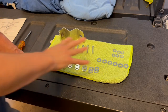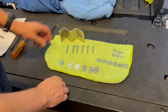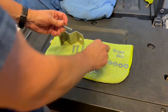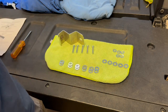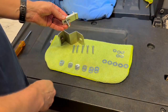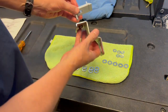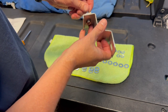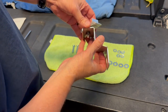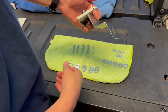I've got the hardware laid out — six pairs of large washers, each paired with a small washer. We're going to take each of the brackets: first take a small washer and a large washer pair, put it through there, then take a pair of large washers and put that on there, then screw it in. This doesn't need to be tight. The order is: small washer, large washer, then two large washers. We'll do all six of those.